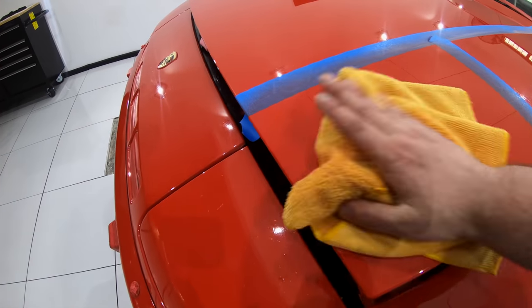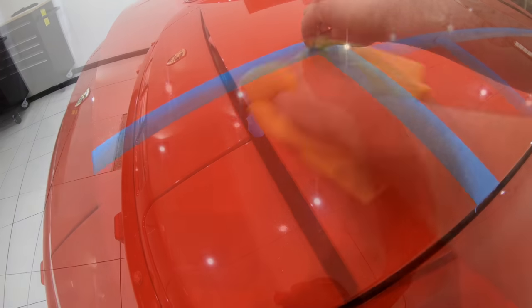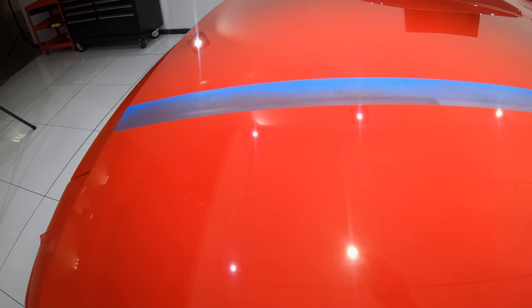Now overall, although its finish isn't all that great on this paint compared to the previous foam pads, it's still miles better than the previous microfiber pad. And whereas I couldn't even gauge the cutting ability of the microfiber pad because there was just so much haze and patchiness in the finish, I can actually see that this pad has removed almost all the defects quite successfully.